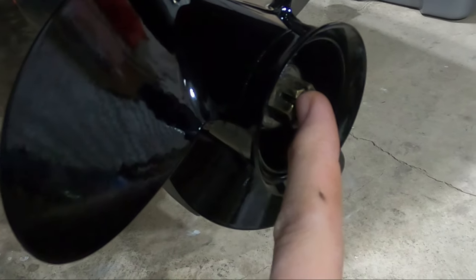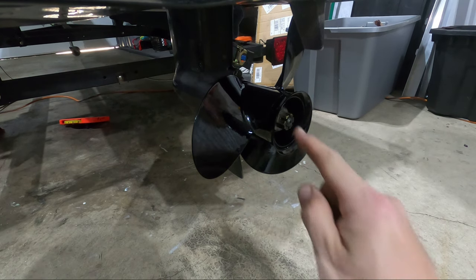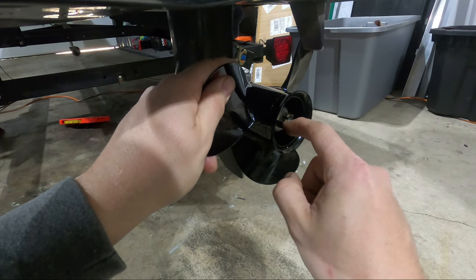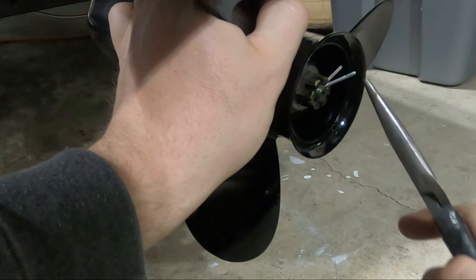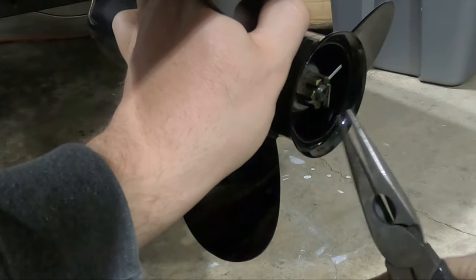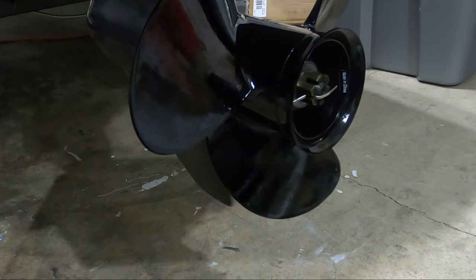Right in there there's a hole — you can see a little bit of light through the other side. If for some reason you can't fit your cotter pin in, just play with the tightness — either tightening a little bit more or loosening a little bit — and that will allow the cotter pin to seat through it. Slide it through the hole, grab one side of the pin and bend it around the top of the castle nut, then take the other portion and bend it back. Once you have your cotter pin installed, your motor is good to be used.